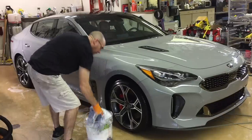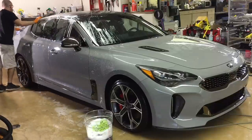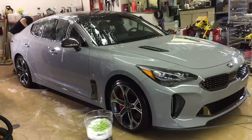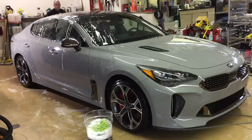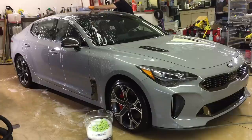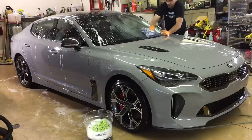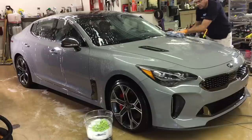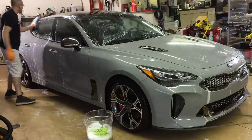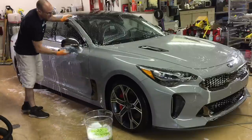For the contact wash, I'm going to use three wash mitts — you can absolutely use more. I use a larger 10-by-10 cyclone mitt on the top of the car, then a second mitt for the passenger side, and the last mitt for the driver's side. They all get set aside, washed clean, dried on low heat, and are ready to go. Those wash mitts never go back into the wash solution and reintroduce dirt. You want to cut down on scratching, marring, and love marks — this is the way to do it.